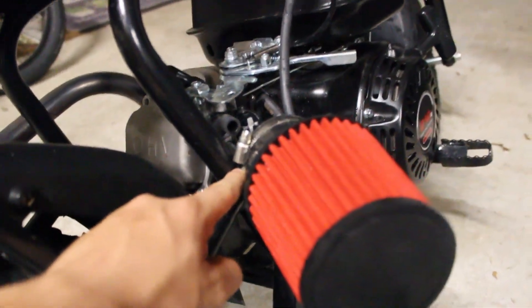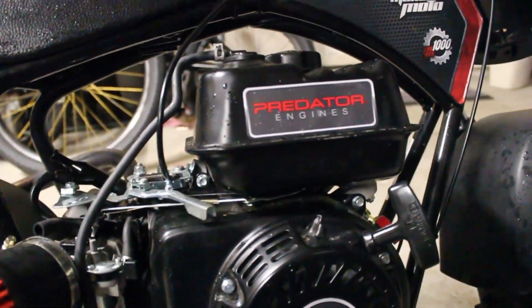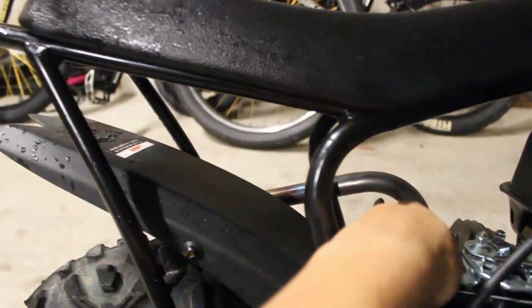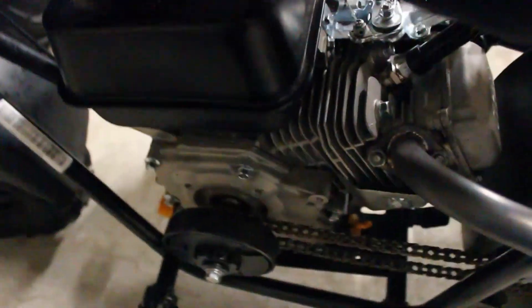Now, if you don't have a stage 1 kit, you're going to have to trim your air box right here because it's not going to fit. Another thing you got to trim on the engine is the old drain plug right there — you're going to have to cut it, but you can still drain the oil because there's one in the back tube. If you want to bolt up a stage 1 kit, I suggest getting one of these pipes or a center exhaust that comes from there to here and doesn't touch this. Mine hits the frame a tiny bit, but it bolts up perfectly with no exhaust leak.